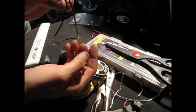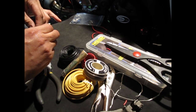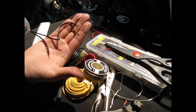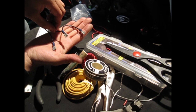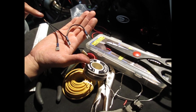Next, grab your third cable and connect it to the bottom of the assembly, twisting them together there. Pre-bend it since that's how it'll be positioned. The final assembly should have the two wires tied together at the top, with three female connectors — one at the top tied together, and the third cable tied at the bottom and bent over. Put the female connectors on the bottom parts, not the top, because the top is going to be soldered to the negative cable on the switch.